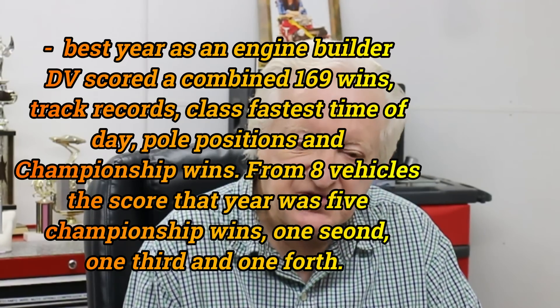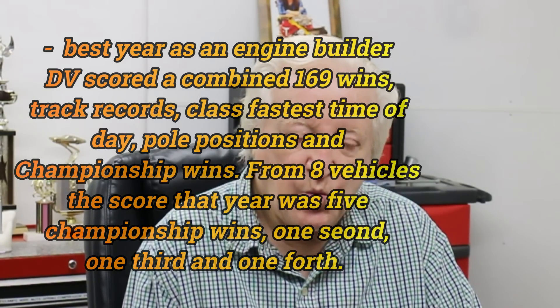In this episode 58, we are going to deal with the vagaries of small block Ford block reliability. The better you are at getting horsepower from these small block Fords, the more likely you are to have an unreliable engine. Block strength is not a great asset. My Caribbean crew chief Mervyn Bonnet and I have probably scrapped in the region of 10 blocks because of overpowering them — and I'm talking about 5.0 blocks here, though the same more or less goes for a 351 block, although not quite as badly.